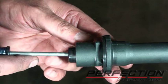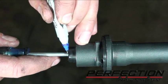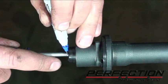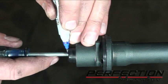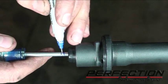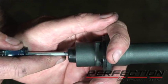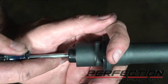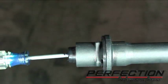How do you know when you're done? In this case, there's a clip that holds the slave cylinder piston in place — I'm going to use that. The slave cylinder is not connected right now. I've got a substitute push rod in there — just a Phillips screwdriver — and I'm going to push in and mark the push rod. I'm getting about an eighth of an inch, but as I push it in, I'm getting a good solid rebound. There's no sponginess to it. It's solid. This system has bled — we're ready to install it in the car.